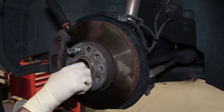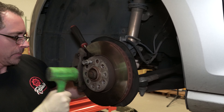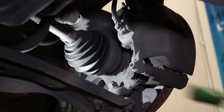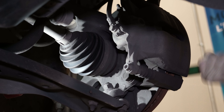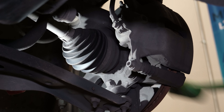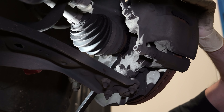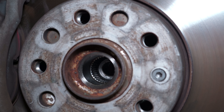That smells bad. Put it back in. Now we have to get the axle out of the wheel bearing housing — it is splined into it. We're threading a bolt in. Make sure you get good thread purchase on this, because if you hammer this bolt without it threaded in all the way, you're gonna mess up the threads and ruin your axle. Once you have the axle loose from the wheel hub — that is the key here — you don't need to push it all the way out. You can do that once you've taken the ball joint off the control arm.